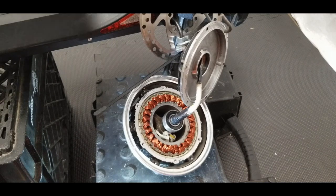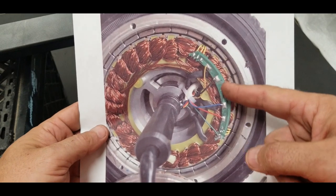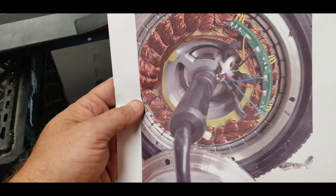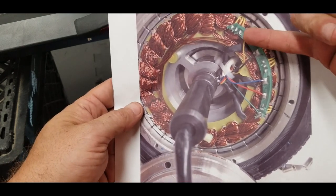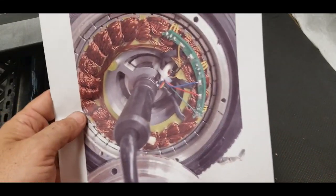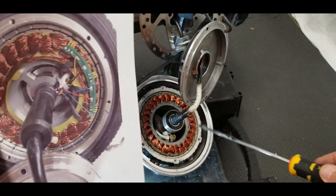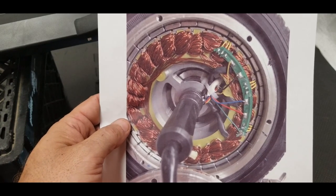Let me show you what hall sensors typically look like in a motor. Like my RS7 — when I took the D5 Plus deck apart and looked in the battery area, I noticed it didn't have the five hall sensor wires. That's weird because my RS7 and some other scooters had that. This would be your hall sensor wires, and there would be a circuit board on the motor here with those five wires attached to it. These would be your hall sensors — one, two, three, four, five — and that's what would be reading your speed. But this motor doesn't have it inside. So it's reading speed with a speed sensor, which is why they have it defaulted to one instead of zero.